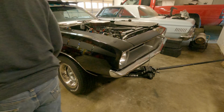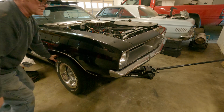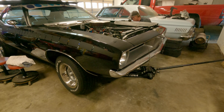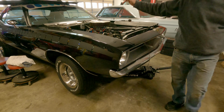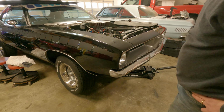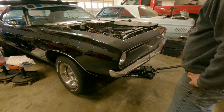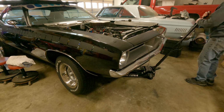Okay, so the front wheels are off the ground. You would hope that's locked up, yeah. And that was locked up. Well, yeah, I don't know, guys. What I was expecting, like I said, was that maybe this side was locking up early. I got a really stiff pedal. It hasn't been that way. Usually I had to pump it with the Chinese Right Stuff master cylinder. So anyway, all right, figured that out.